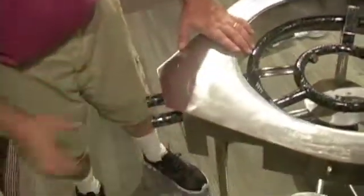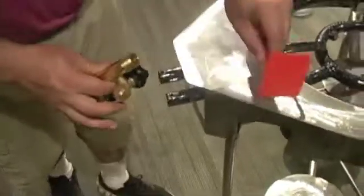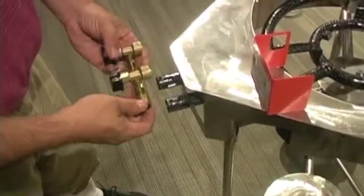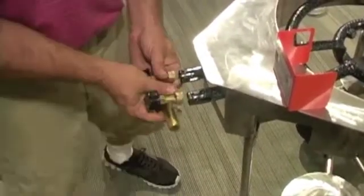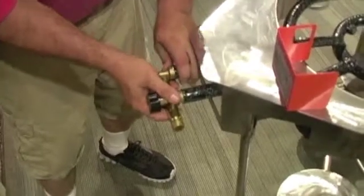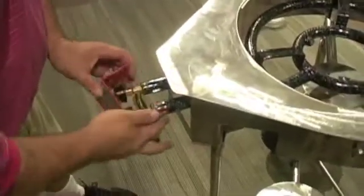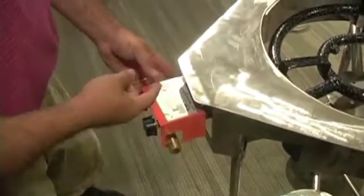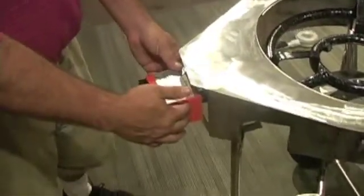Now that has the dual ring burner pipes coming out through the front, and then you have to reassemble the pipes, so we're sending them to you unassembled. You take the valves oriented so that the holes can be located when you put a screw there, and this has a little spring to it. You just got to pull it open a little bit and then line up the holes with the holes for the screws. Slide on the cover and then just lift up the label and put the screws in, and you'll have a bag of screws for things like that.